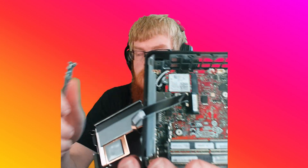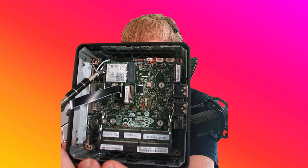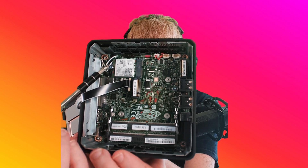So this is the hard drive — just a tiny little stick. There's a little screw that we need to take out because it holds down the hard drive. It's right there, that little guy. I'm going to unscrew it. Some of you guys can't see me sticking this in here, but it really does just pop right in. Then I'm going to put the screw back in.